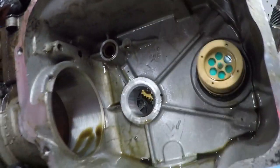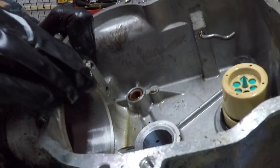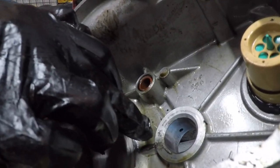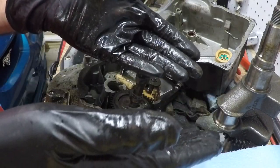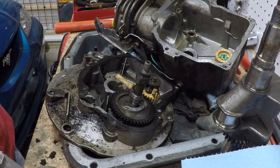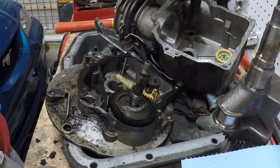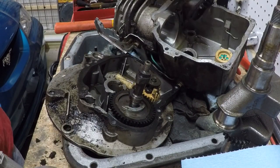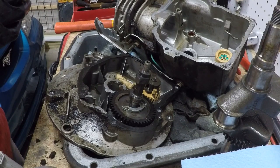The oil is being pushed up through the top of the camshaft by the oil pump. The top of the camshaft sits up here, and there's an oil passageway — there's a little hole here and a hole at the top of the crank. The oil is pushed up here and falls down over the crankshaft, so the crankshaft and the rod and crank bearing are getting oiled. That also acts to sling oil around inside the motor. As the crankshaft is spinning, the oil pump is pumping oil up to the top of the block, and it's slinging oil into the cylinder, the valve area, and all of that. That's how the oil pump on a Tecumseh push mower works.